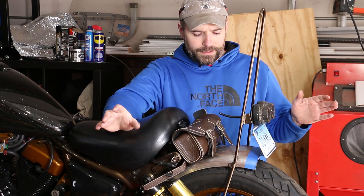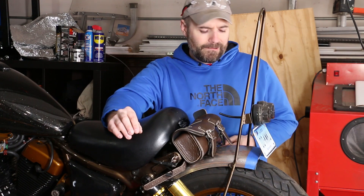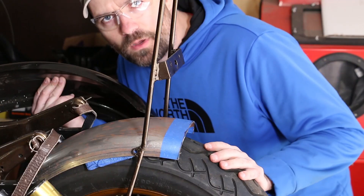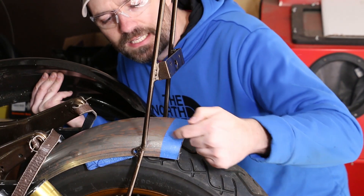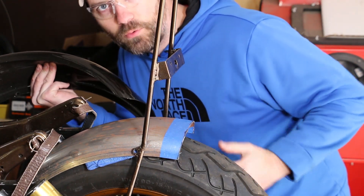After a lot of looking at this, I don't want to have to do this again. I think it looks pretty good. The sissy bar did have to come up a little bit just so the bolt holes would line up, and I think it looks pretty straight and even. So we'll go with this — I'll sandblast the fender and we'll get going on the powder coating. One last thing I've got to do before I sandblast is curve the back of the fender so it has a nice smooth edge and not a jagged point.